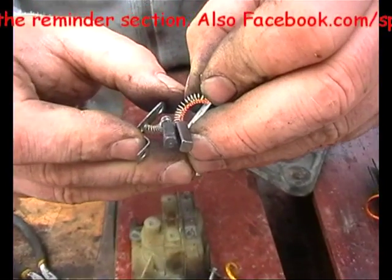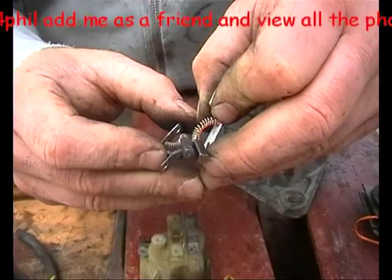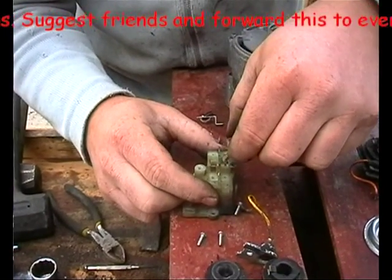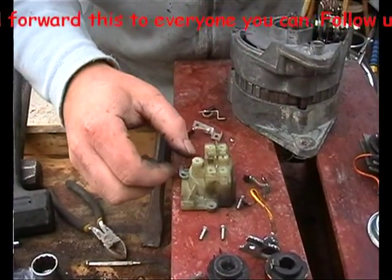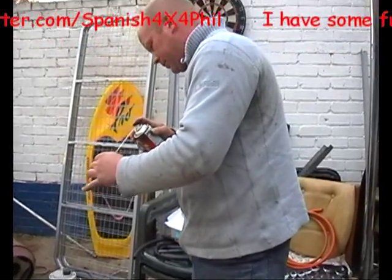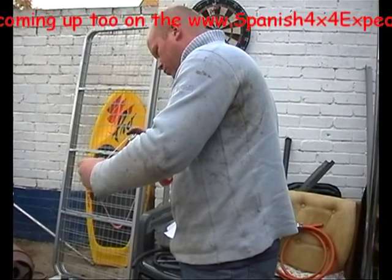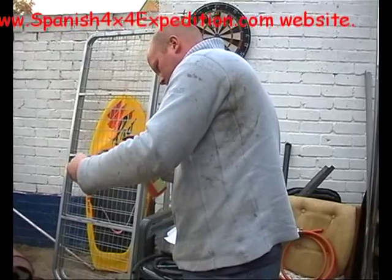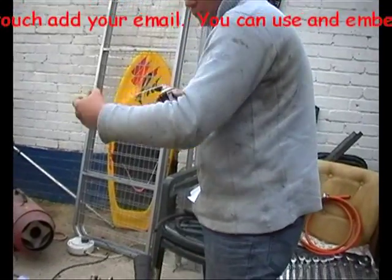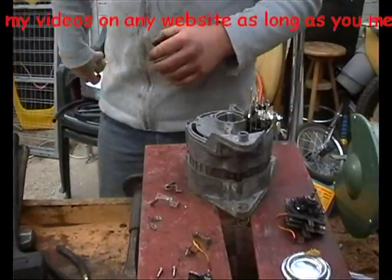The brush is not particularly worn on that one. And it's not something you have to replace every time your alternator fails, but for 60 pence it's not worth messing around with. Pull the other one out. I'll give that a quick squirt with the carburetor cleaner — wash the rest of it out. The carburetor cleaner evaporates nice and quickly, so that should be alright in a few seconds by the time we put it back together.